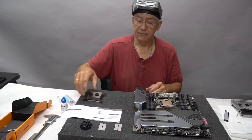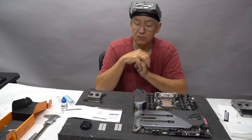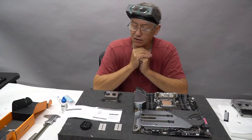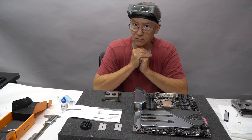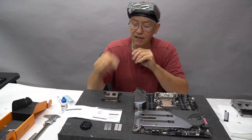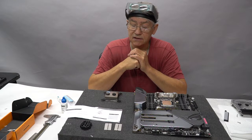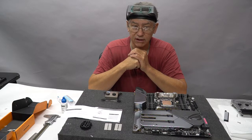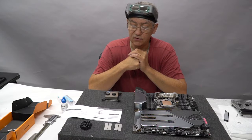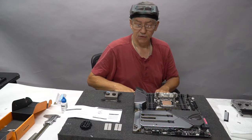So that's it. I just wanted to bring that up to speed and why I chose not to use the monoblock. The monoblock is a beautiful thing. I just thought that since we're at this point, and I've had such tremendous luck with the Evo Supremacy water block in the past, and it's regarded as probably the best water block out there. I do like the way that it's tunable, and I did contact EK directly because their manual does not list the latest 2066 CPU in here. It lists an older LGA 2011-3, and EK did tell me that you use the same jet plate and the same insert for this one because internally the size of the die is virtually identical. So that's been verified. That's it. I'm going to go ahead and put this together and then we're going to get it in the box.